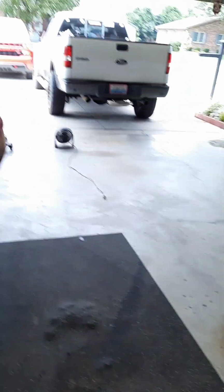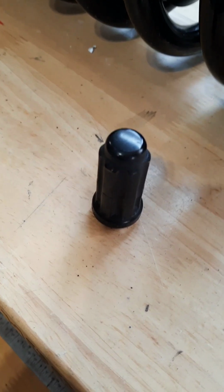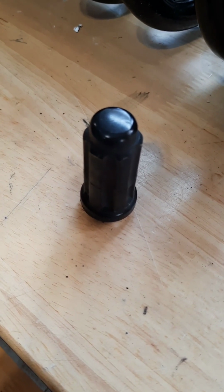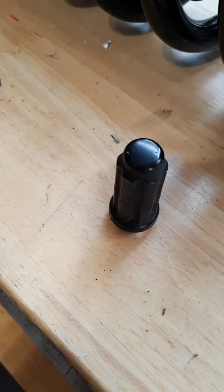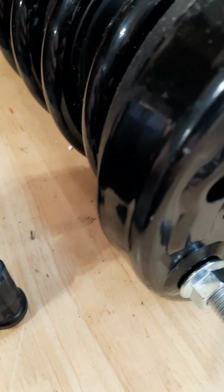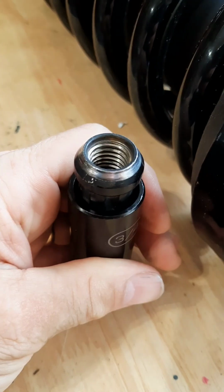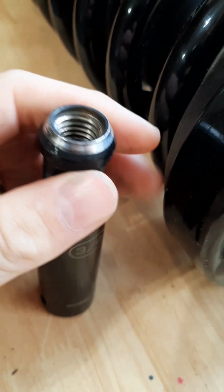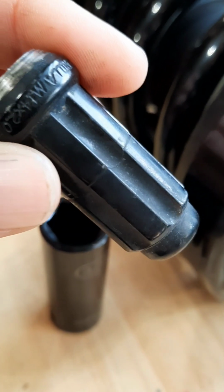Okay, all these boxes are going on that. A certain tire company with big in the name forgot to give the socket key for these splined lug nuts back. So what you can do is find a socket and try to find one that fits. This one happens to be a 3/4 inch, fits perfect. So if you ever lose a splined one, try a socket. There's a socket that'll fit it. A lot of these also are 19mm.